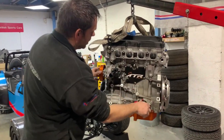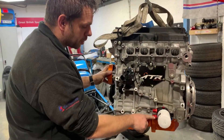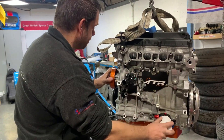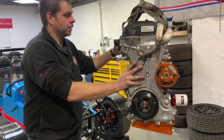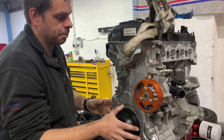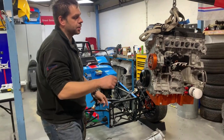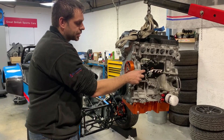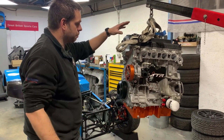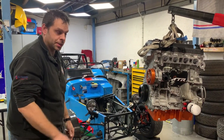The engine itself now has the lightweight steel flywheel fitted, the clutch upgraded as we saw. We've put provision on for the oil cooler system — there's an oil cooler takeoff fitted; easier to do before it goes in the car. We've got the revised water rail which utilises the original 2.5 casting, and that combined with a 60mm core radiator means the customer gets a whole new coolant system. Because it's a high performance variant, we've gone with a lower thermostat — normally 98 degrees, this one's 82 degrees — just to keep the engine nice and cool. Spark plugs are upgraded and all in. Engine's fully checked, should be in the car by end of today and on the dyno tomorrow.